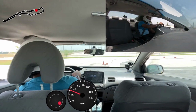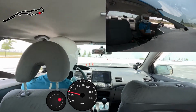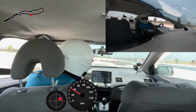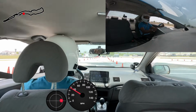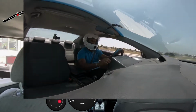I'm impressed with how different the braking feel is with those stainless steel brake lines. However, with the current tire setup, the ABS tends to kick in quite quickly if you do not use threshold braking. Heading uphill feels really sluggish in this car. I try to combat it by keeping some momentum through the turns. The R18 enters max torque around 3,500 RPM and will hold it till 5,500 RPM. I reached the finish line at the top of first, so at least that's somewhat ideal, and I'm not between gears.